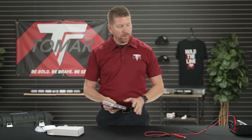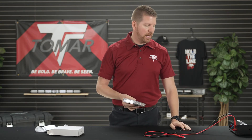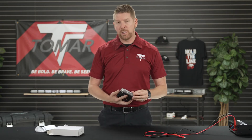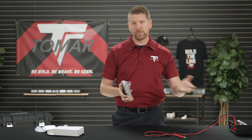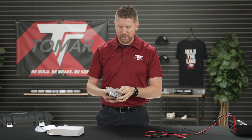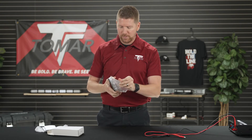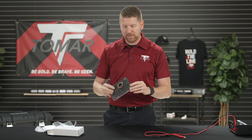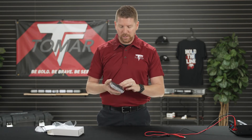To make changes to this lamp we are going to use a 12 to 24 volt power source. In this case we are using one of the pyramid power boxes, which you can get on Amazon or anywhere. You can use a battery, just as long as whatever source you're using for programming the light is the same source for the power on the ground. All of the lamps come with a protective coating on the front which also states the torque spec — a max of six inch pounds. Anything further than that you risk cracking the plastic in the lens or the base, so we do want to handle it with care.